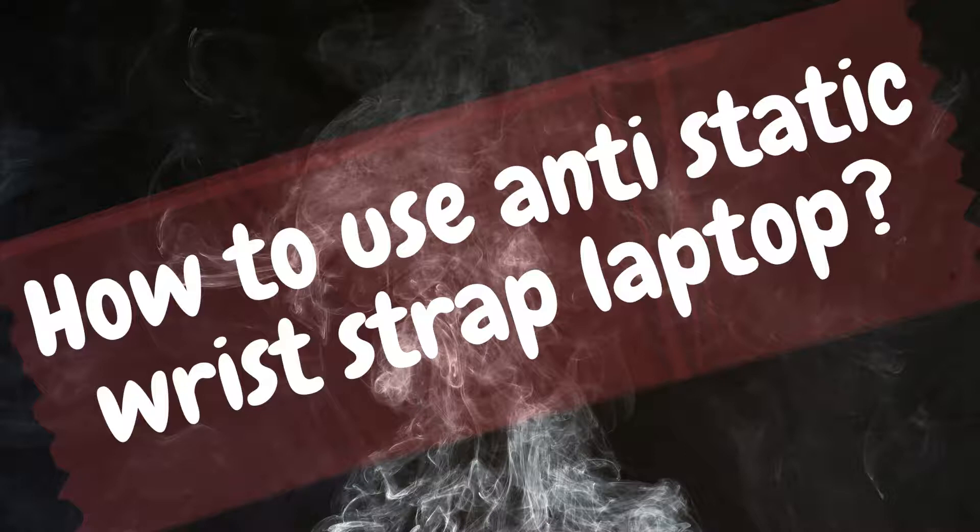Step 1: Wear a strap with a metal component that comes into contact with your skin. Note: it may be worn on any part of your body, not only on your hands. Step 2: Plug the power cable into the outlet after turning off the power source. Step 3: You may attach the alligator clip to the power supply screw or the PSU fan grills. Note: any metal should work as long as it is bare metal, as some paints include insulation and some do not.